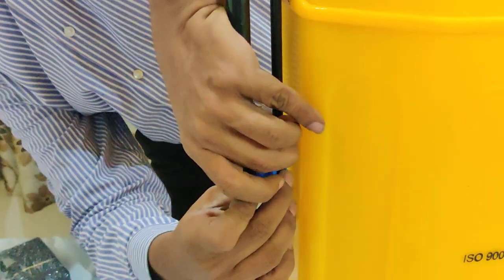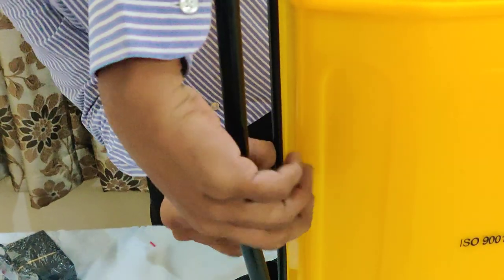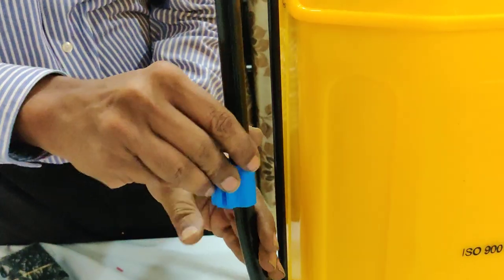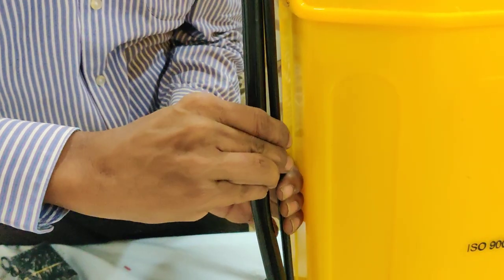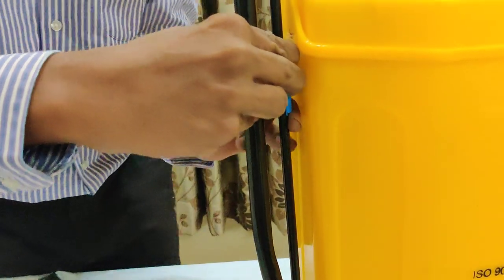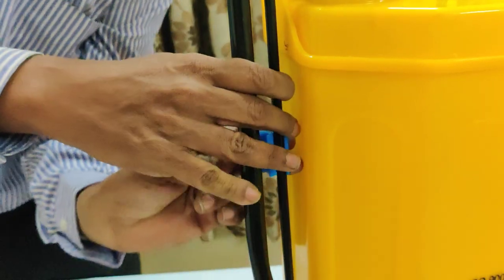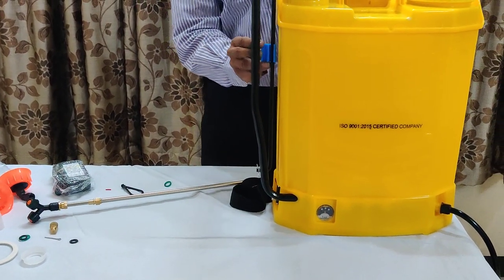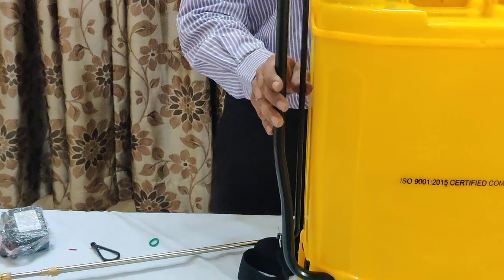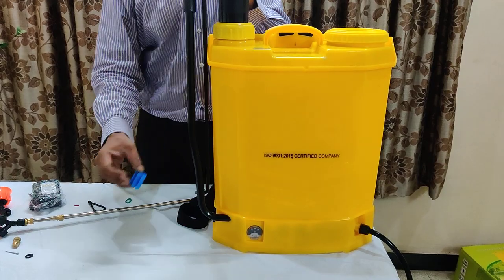If we are not using it with battery, or if the battery power goes off, what you have to do is remove this nozzle, remove this cap, put this nozzle over here, and put this cap back to this place. Whichever side you are using, the other has to remain closed, otherwise water will overflow. Because of being a new piece, it might be a little bit hard in the beginning. Mostly we will be using the battery operating function, so just try fitting it and we will come to the next step.